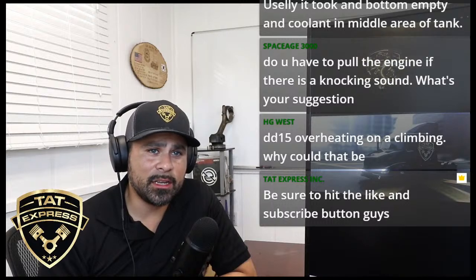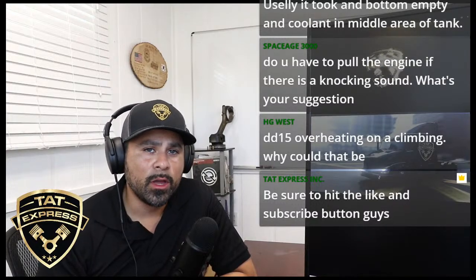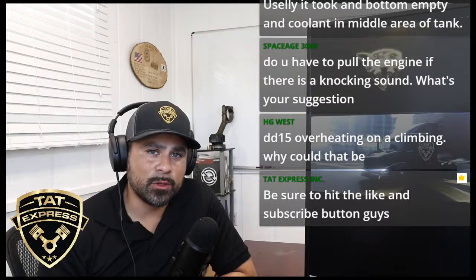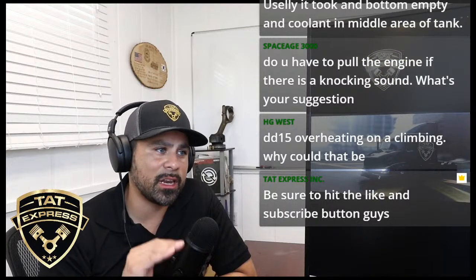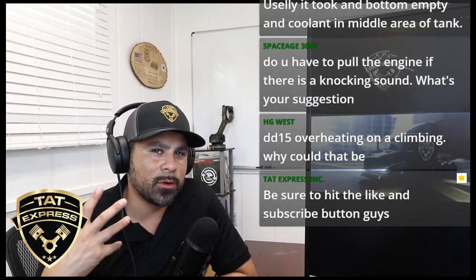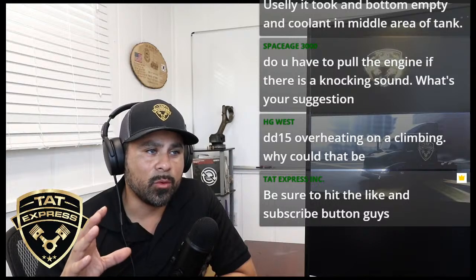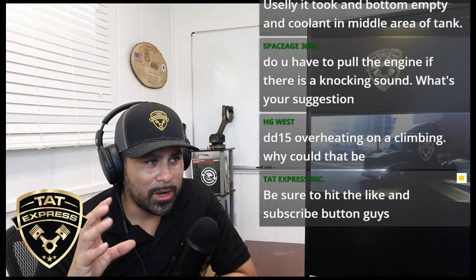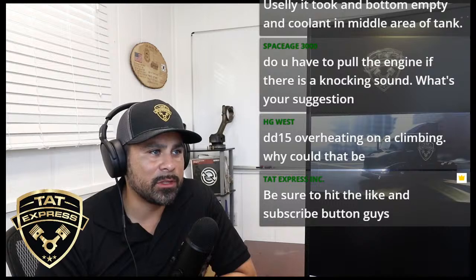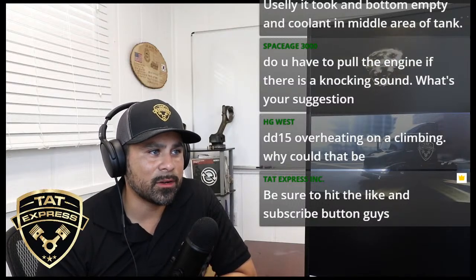Opposed to the DD15, which was designed with emissions control in mind. So it wasn't backwards, where the engine was designed before emissions. This is why I'm not a big fan of the last 60 series models, because I just noticed a difference. If you're a mechanic, you would notice the difference in how the engine sounds when you're running it. The later models with the DPF filters sound really noisy. A DD15 sounds really smooth, everything sounds together. The 60 series emission systems, with the DPF filter on there, sound like they're coming apart.